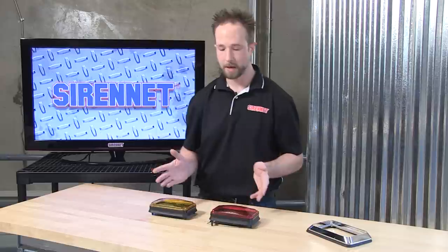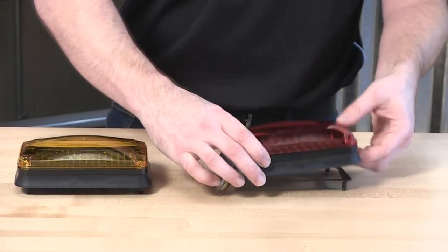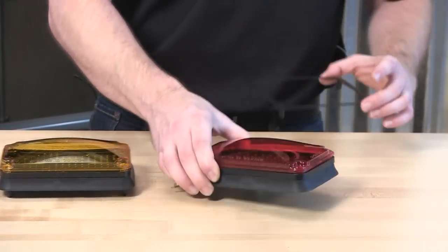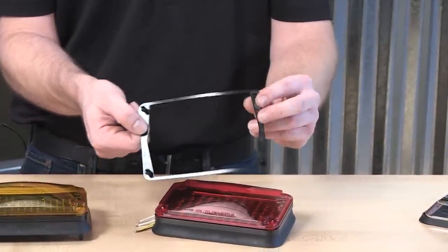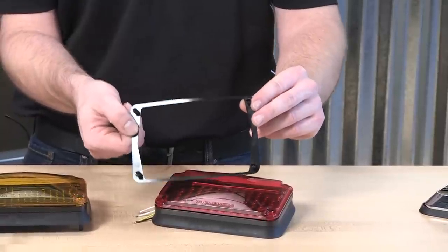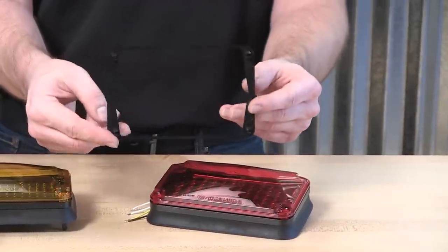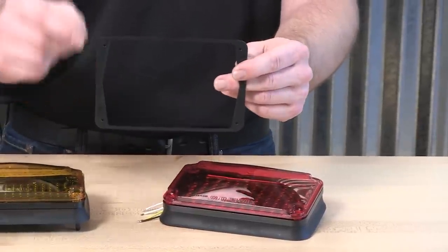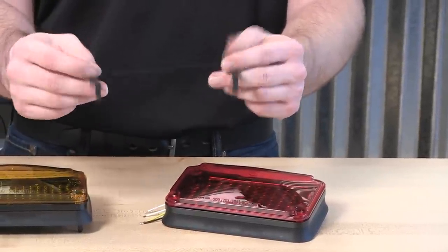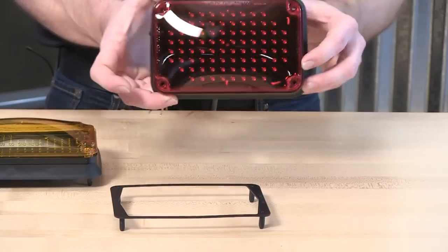Now the light heads themselves, you can do a few different things for mounting them on the vehicle. Out of the package, they will come with a base foot — a 600 series contoured base plastic component. The tabs here will actually allow for the mounting screws that come with these light heads to be run through the body panel and allow the head to be more snugly secured. You'll take a drill bit, drill in using this as a template, making 4 holes. This will then pop into place, and the mounting screws will tighten through the holes in the light heads.